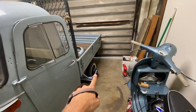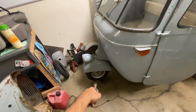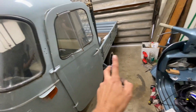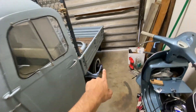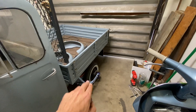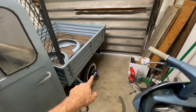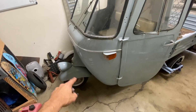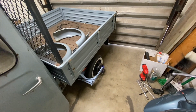So enjoy. You've got disc brakes on the back and drum brakes on the front. Fortunately, just the way physics works with vehicles, 70% of your stopping power comes from the front and only 30% comes from the back. That might be a little different since you'll have some weight back there and two wheels, but the disc brakes definitely give you enhanced braking ability. Plus there's a very slight regen braking — so when you let off the throttle, these motors, like a Tesla, slow it down as well. Really, you can pretty much drive around with just the front brake, but those rear brakes are on there and they're strong, which is always a good addition.